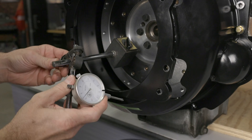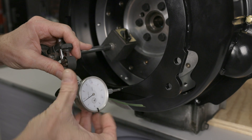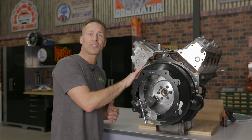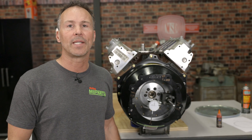Another good practice is checking your bell housing parallel. This can be done with the dial indicator and will tell us how close to parallel the back of the block is with the back of our bell housing. If yours isn't within spec, you'll need to double check for any imperfections or debris that may have been trapped between the mating surfaces. Taking the extra time to make sure that your transmission's bell housing is correctly indexed will help you get the most out of your transmission's potential, improve shifting, and even help extend its life. To learn more about any of the products used today or to see the complete lineup of driveline products, visit us at Holley.com.